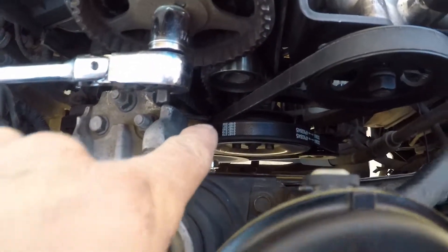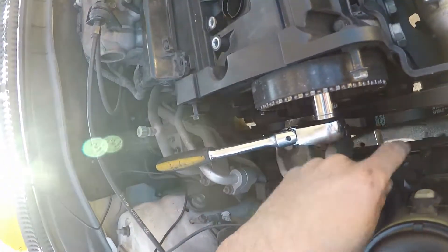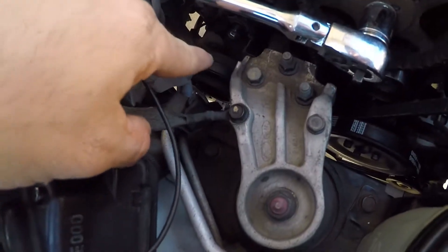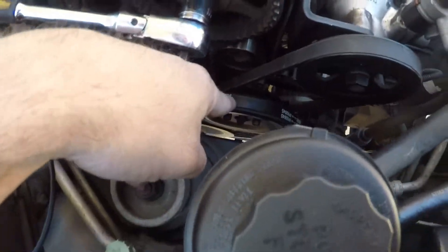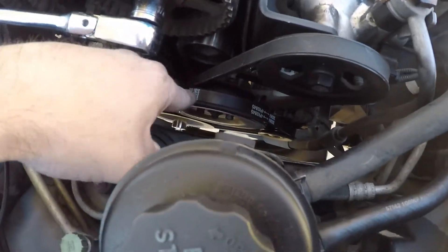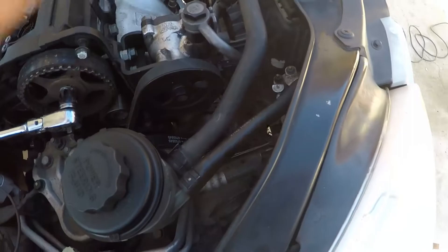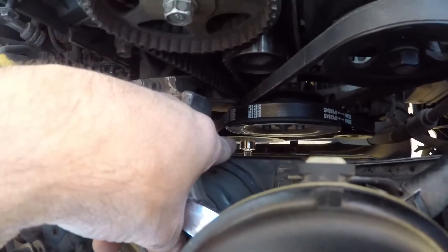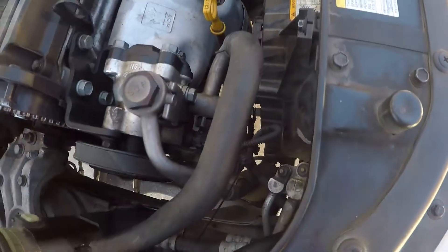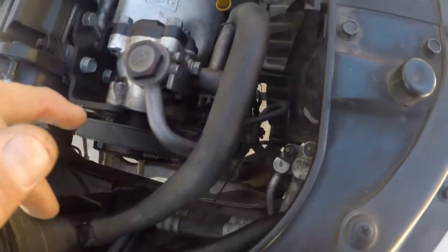I am going to remove that plastic back there. I'm going to have to remove this belt, that belt, and the air conditioning belt. This one runs off of the water pump belt, and then this belt here runs off the crank. So that one runs this and this one runs this. The crank down there is a 20-tooth sprocket. First we're going to loosen up this one.